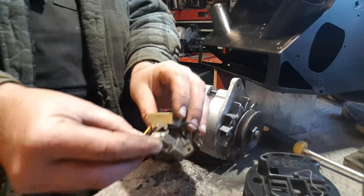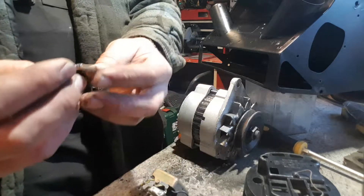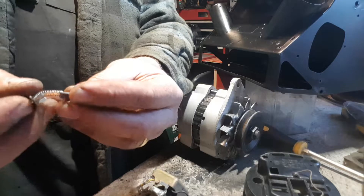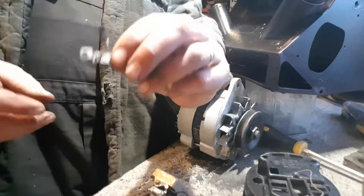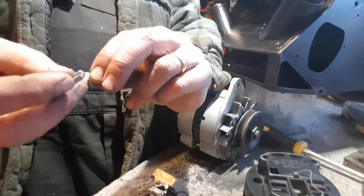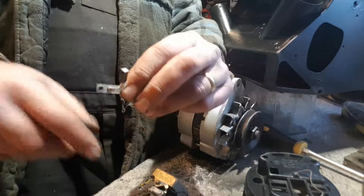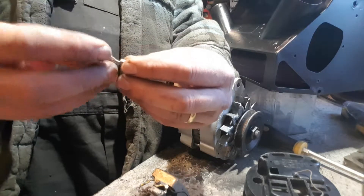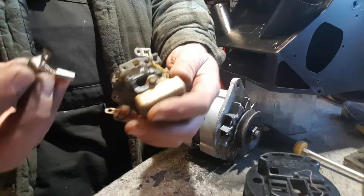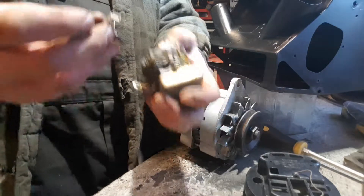If I take the cover off here, you'll see there's quite a long spring that will come out, followed by what I would class as a healthy-looking brush. You may well find that when you replace this, you have to replace just the brush component. That might be a bit of a faff because you're going to have to drill a hole through here, bring the wire through, and find some way of securing it onto the bracket. If you're buying it from Lucas, I would imagine you'd buy it with the bracket and everything attached. Both of these brushes are exactly the same — they've both got exactly the same bracket on the top.